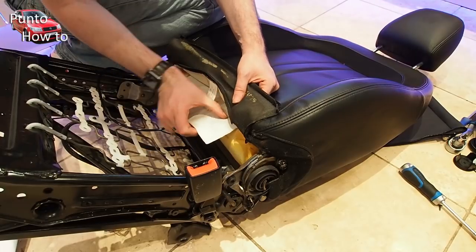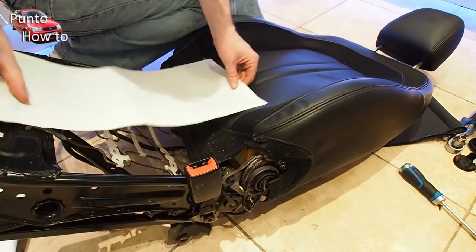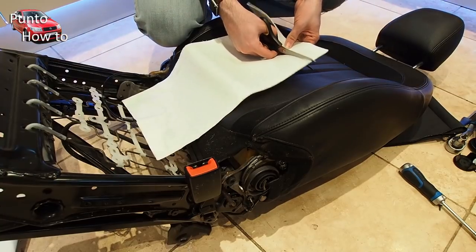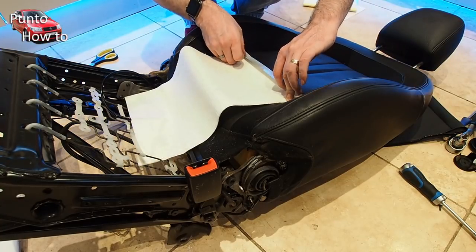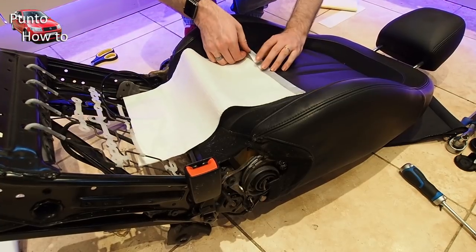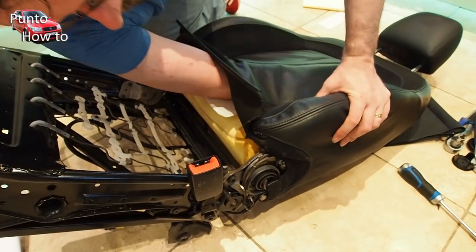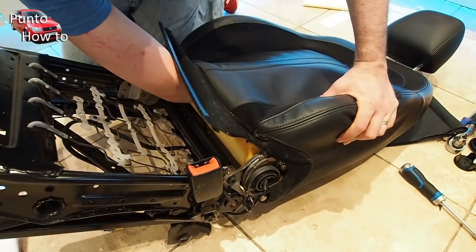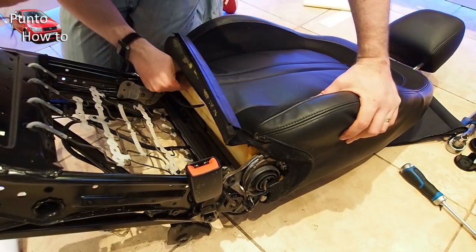We need to trim a couple of inches off the top end of the pad. I measure that roughly with my hand, translate that to the top of the pad, then get a pair of scissors and trim the top part of the heating pad off. I seal the end with a piece of the special foil tape included as part of the set, then feed the heating pad back up into the cavity in the back of the seat as far as it'll go, making sure it's nice and smooth and flat with no creases, so it's not going to get trapped or snagged on anything.